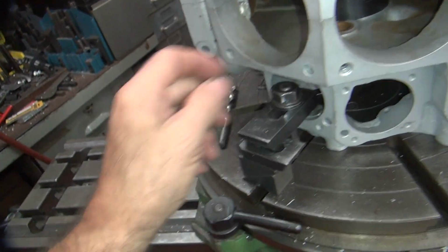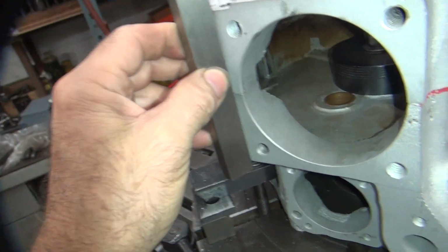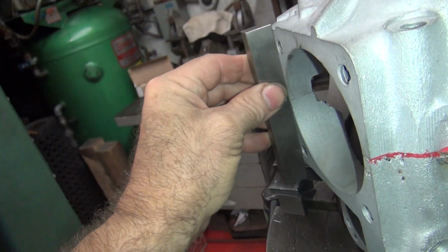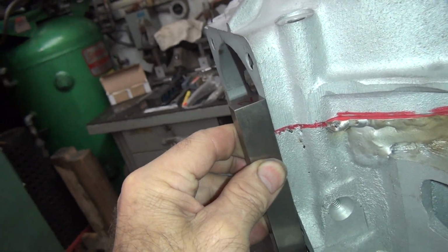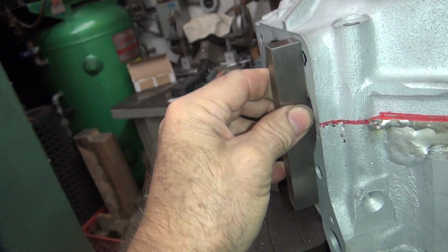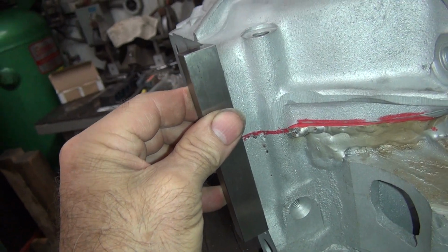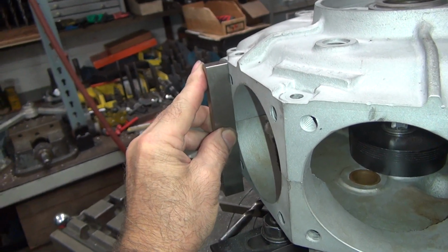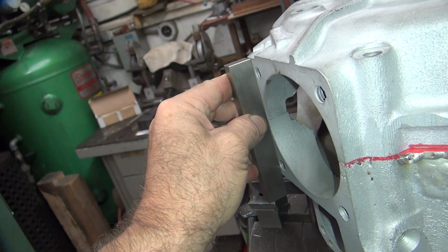The motor mounts don't line up on that side, they'll have to be recut. The next thing is you check these surfaces here and see how close they are. See the difference? That's high. That one feels good. That one's high. Hard to get a flat surface to work off of here. Seems to be pretty flat. You got high spots where every stud is, plus the edge here. It's hard to get a reference. So we're high on these two corners. This one feels good though.